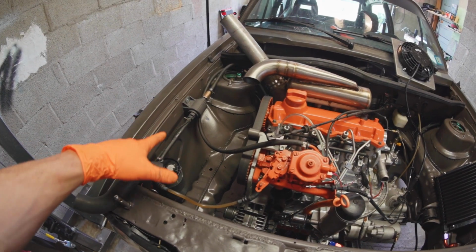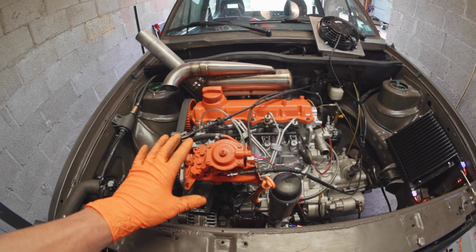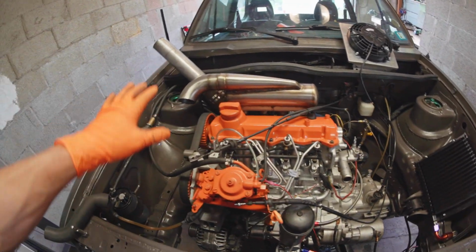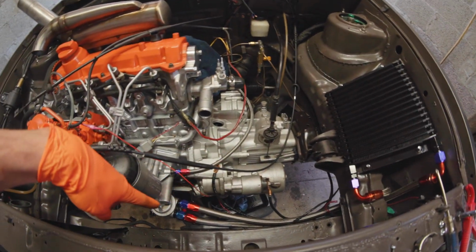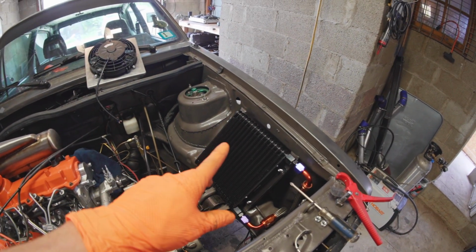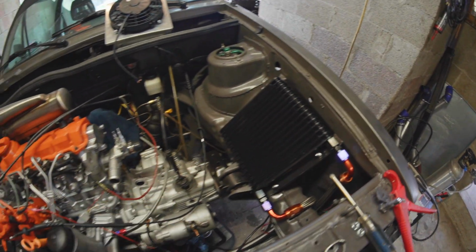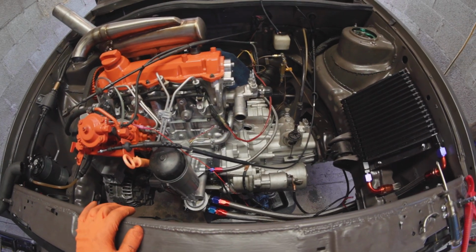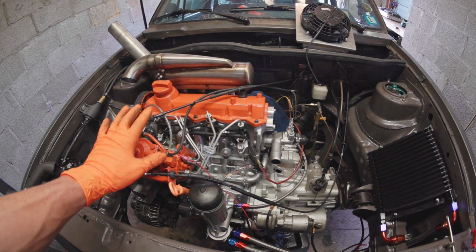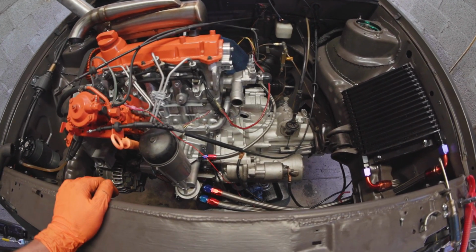This is where I'm at right now. I got my fuel lines plumbed approximately where I want them to go. The car turns on and runs. There's no intercooler piping done. My oil cooler is run and connected, and I think that's a good spot for it, and I made mounts for it that are actually welded to the car. So that leaves the last big thing to actually be able to turn this motor on and let it warm up and break in, which is the cooling system.